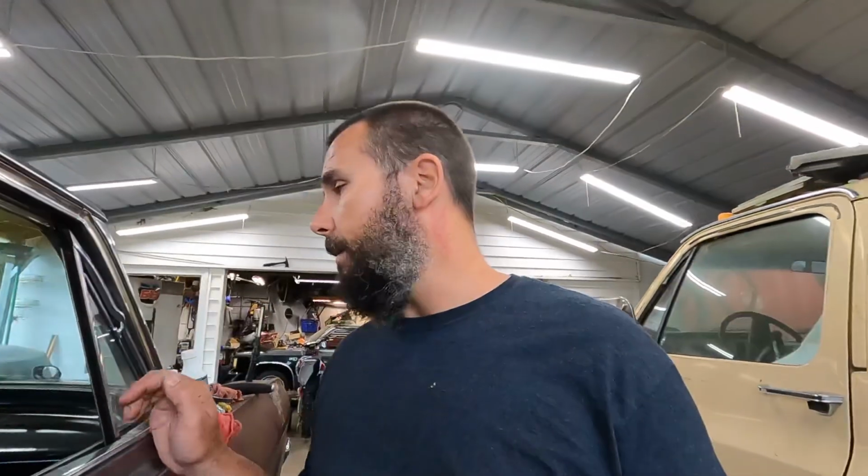I'm pretty sure I covered this before, but now that there's actually places to put your feet for the floor, I can't put my mufflers where I had them. So I'm gonna have to put the mufflers where GM put them, which is basically right under the driver and passenger, right under the front floorboards where your feet go. And that was another reason I was gonna put some sort of sound deadener, thermal barrier, or whatever in the floor of this car, because I don't really want to make it any more miserable to ride in than it will already be during the summer.